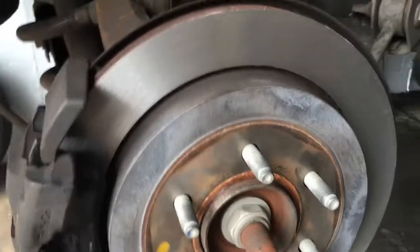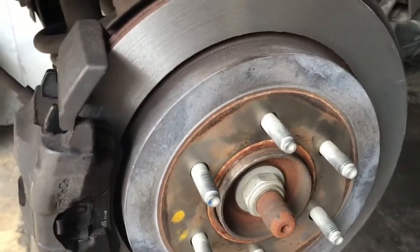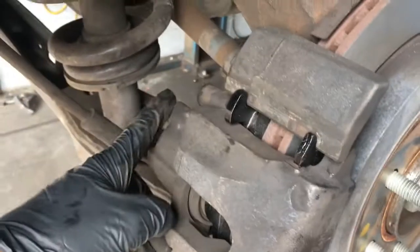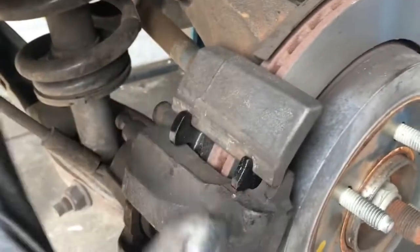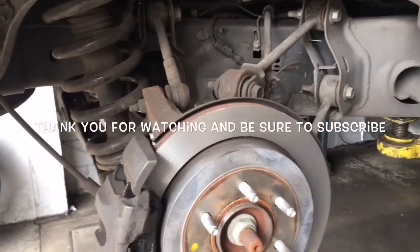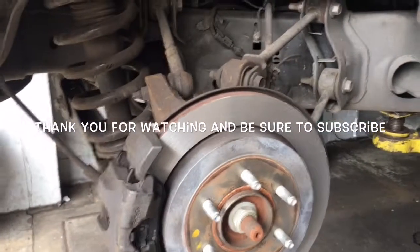Go ahead and bolt your wheel back on and torque it down. After that, lower the vehicle down. The most important step is to pump the brake pedal — pump it until all the fluid goes back into the calipers and you should have a nice firm brake pedal. If you don't have a firm pedal, you've got air in the system and you'll need to bleed it — right rear first, then left rear. I recommend just bleeding all four wheels if there's air in it. I've actually never had to do that after pressing the piston in without opening the bleeder screw. Remind yourself to double-check your fluid level in the master cylinder when you're done. That completes rear brakes on a 2007 Ford Expedition. I'm Brian Esser from How To Automotive — thanks for watching and subscribe for more videos.